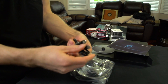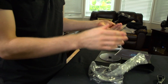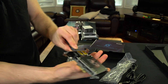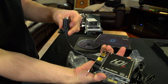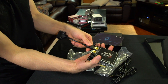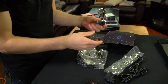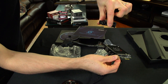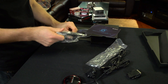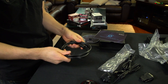Let's have a look at the included accessories. There's just a 3.5mm audio cable. They also include a DVI to HDMI adapter — so if you wanted to capture HDMI in from a DVI output on a video card, you'd use that. You might go HDMI out to your DVI monitor and everything would be set. They include another adapter for the other direction, so you can go out from DVI from your video card and then use a small HDMI cable to go into here. They actually include the HDMI cable you need, so they include pretty much all the cables you need to get going.